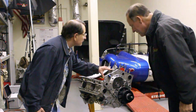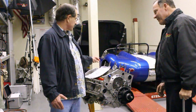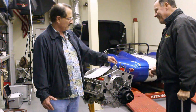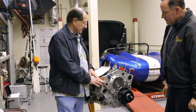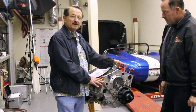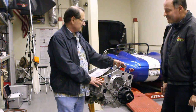Well, let's see — we're at 48. Now I should explain why we have this 2-thousandths variation. I think I may have bumped it, actually. Well, you may have bumped it, but even if you didn't, there's another factor at play here: this is an aluminum block, and we've got a magnetic base for the dial indicator.